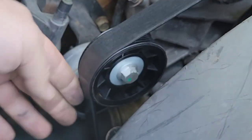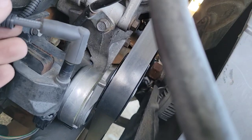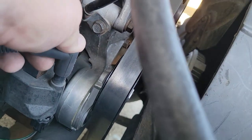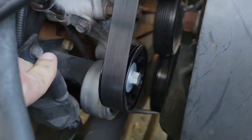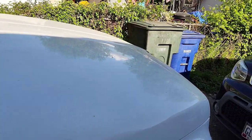Then you go ahead and put the clip back in right here. Grab your wire and make sure when you push it down that you hear it click — you'll hear an actual audible click. And there you go. Alright guys, that's it. We just put the new belt tensioner in on the 2001 Dodge Ram 1500. Here's the old one — there's no resistance behind it, so it was bad. If you heard this truck before, it was very loud. But now you can hear a faint squeal, and that's just the idler pulley, which I ordered. But I got tired of waiting for it to come in, so I was like, we've got to start some work. So I'm pretty happy with how this turned out.